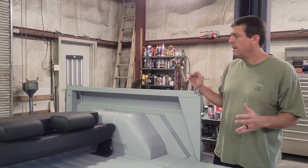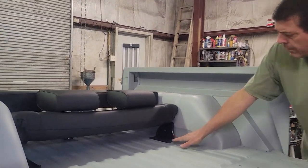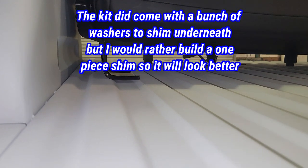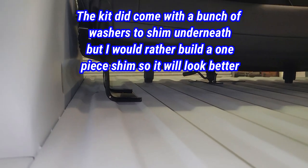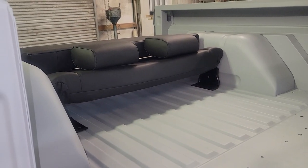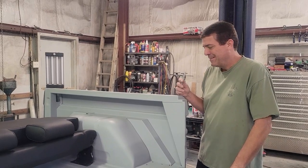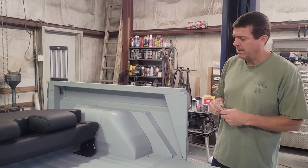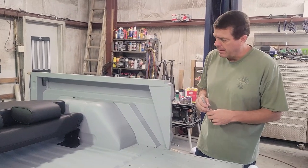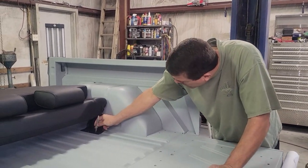Our seat is where we want it. The brackets are sitting right on top of the gap in the bed, so there's a gap underneath. I'm going to need to get some flat stock and build two spacers — I don't want to just tighten everything together and deform the steel after all this work. It's not a showstopper; I can mock it in today, test it out, and do the spacers later. For now I'll just reach in with a sharpie and mark the holes.